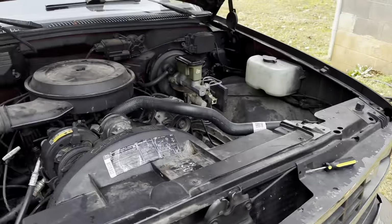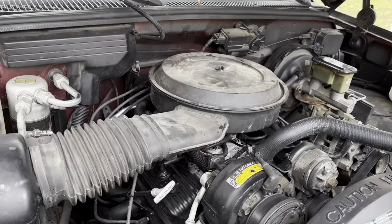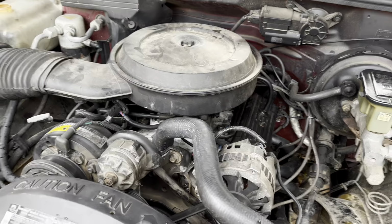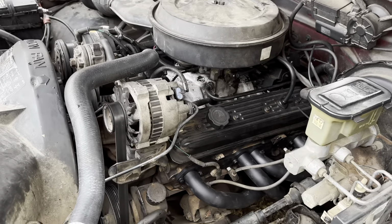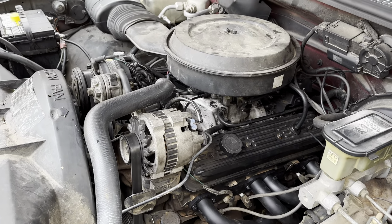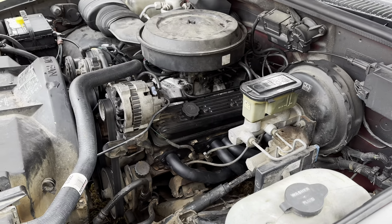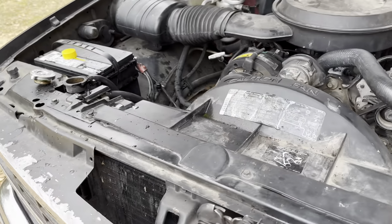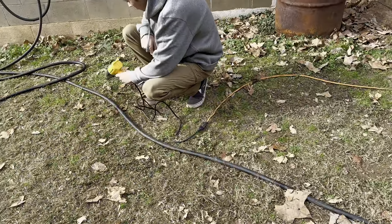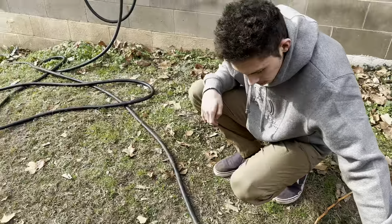So we're trying to flush the radiator and all that stuff, getting ready to put new coolant in it. We got the heads on and all that's back in there, the intake, all that. Lashed the valves last night, had Corey come over to make sure I didn't screw that part up. I'd seen Corey and others do it a million times, but I'd never actually done it myself. So I actually did these last night. So far, so good. No bent rods or anything. We've already ran water through it a little bit, and so now we've got to heat up the hose because it is solid ice. We got Kel working on that, doing a great job. Wiki wiki.